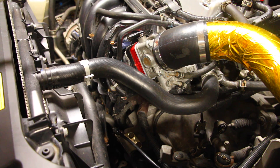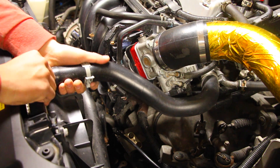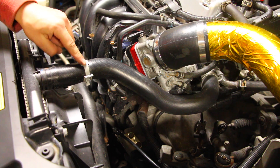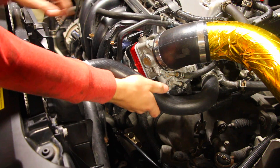Push it up like that so you're safe, and then from there you can slide off the upper part of the rad hose — and from right there you can already see that it's starting to leak a little bit. I'm going to push that back on and take off the clamp found over here on the other end of this coolant line.